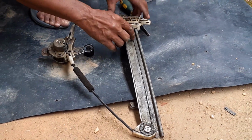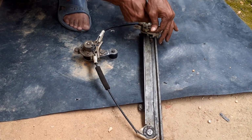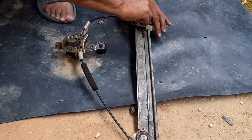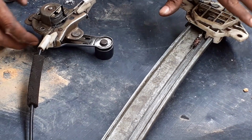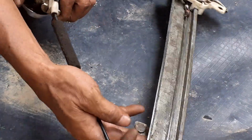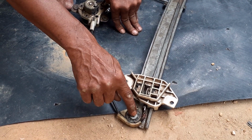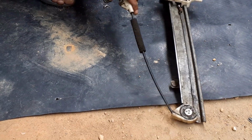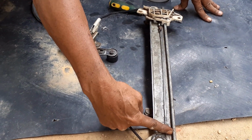Okay? When that is done, I see some guys make a loop and tie the cable and then clip it off. Because somehow when the cable ties, it must firm up and then you put it through the next one. But remember this carefully. The closer you do it to this end, the better for you, because you know why? If you do it 2 inches too much or an inch too much, this is what's gonna happen. When you come up to the other end, it's gonna catch this bearing here and it won't be able to bring the glass all the way up. So the whole trick about this is to ensure that you have it as close as possible here so this can go maximum height. All right.